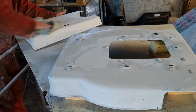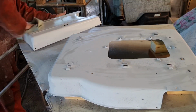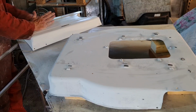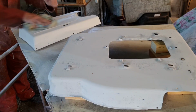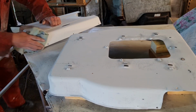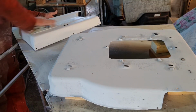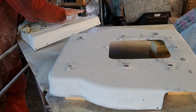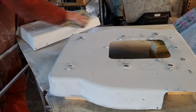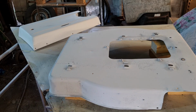Now all of them places had the top of the line ovens, and I'll tell you why they use spray booths and paint ovens. Number one, yes, they are cleaner, but number two, it's all down to time. When I spray this today, I won't be able to touch it until tomorrow, because I'm letting it air dry. It'll be touch dry in a couple of hours, but certainly not dry enough to mess around with or polish. So really, you've got to leave this overnight.